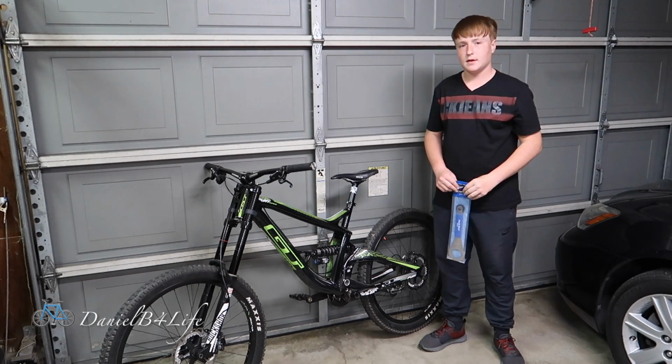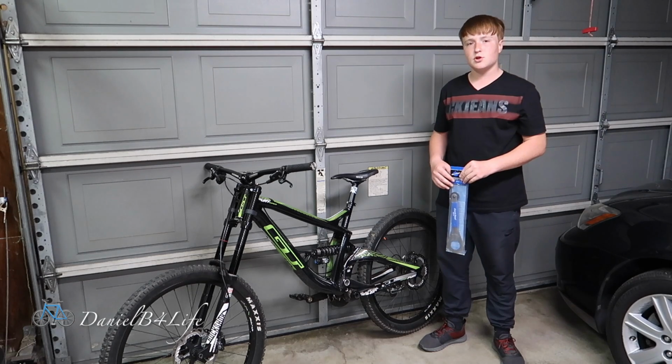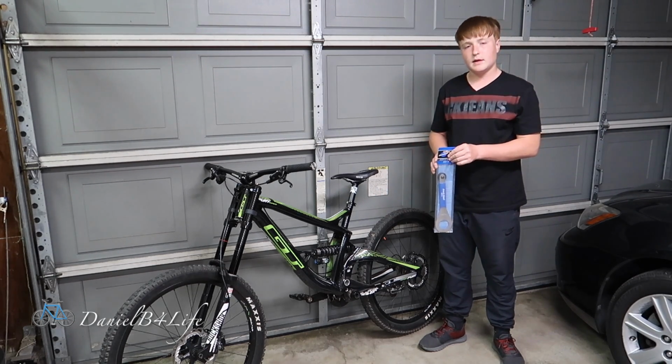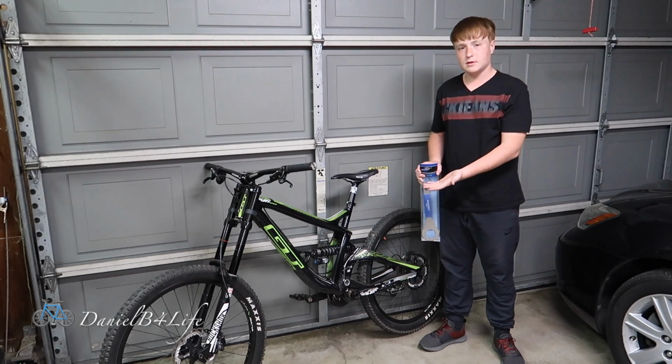Hey guys, welcome back, and in today's video I'm going to be fixing the creaking noise on my bike. After a little research, I found out that the creaking is in the bottom bracket, and that's mainly due to either there being dirt in there or not being greased enough.